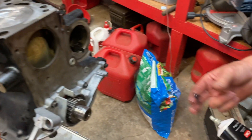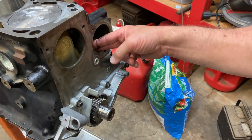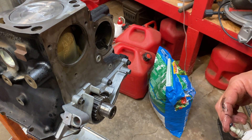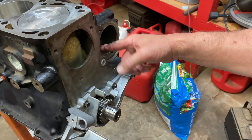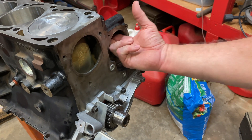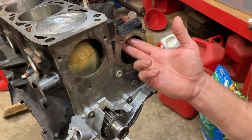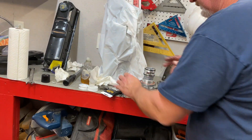So let's go ahead and put some there, put some right out here near this surface here as well. Everything just slides real good. We'll try to keep our gasket mating surface relatively clean here, although it's a rubber gasket — it wouldn't hurt if it had a little bit of oil on it as well. I think we got everything lubed up pretty good there, inside there, and on our oil pump here.